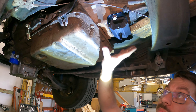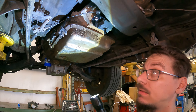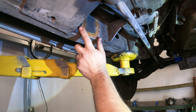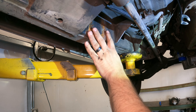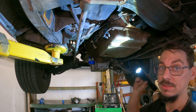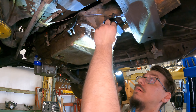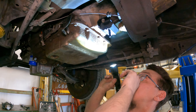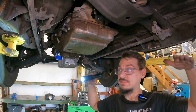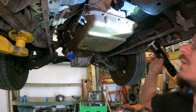We're going to do some CAD — my kind of CAD, not the fancy kind — and figure out placement based on where the mount was for the last engine, but we'll make it so it unbolts. When things are permanently affixed it's really annoying. I'll also plan it slightly higher since the mount will compress a little when weight is on it. If it doesn't look level, that's because it's on a lift — we already checked the angle on the ground.